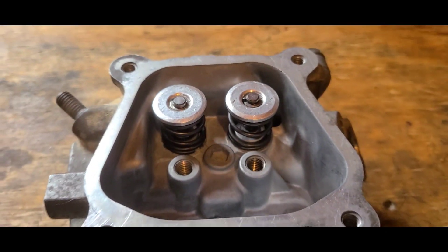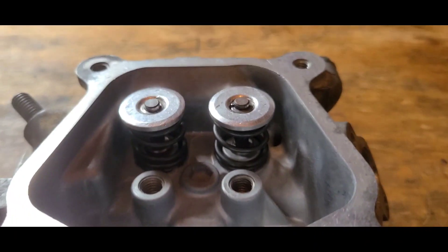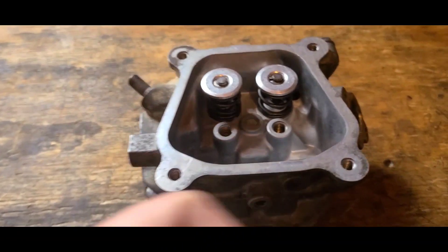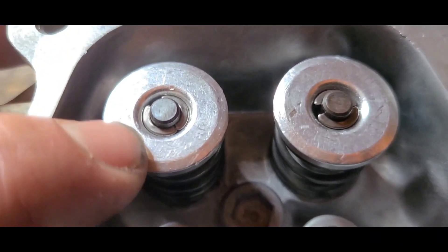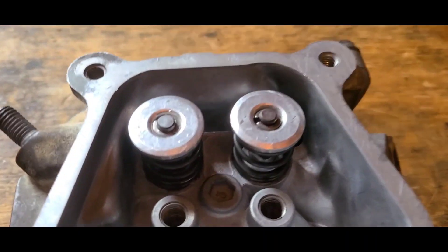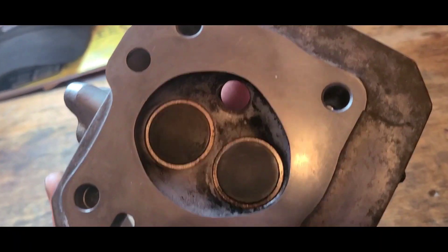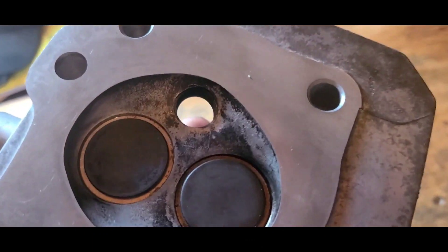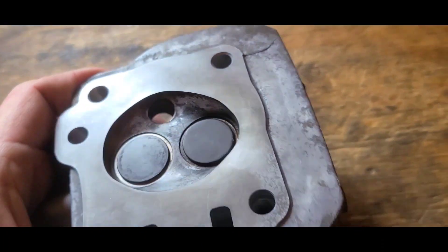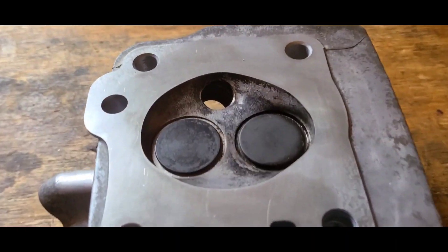These billet split retainers aren't the hardest and they're not the easiest. With the .22s, not that bad — I was able to do them with my thumbs. I just do one of the retainers at a time; that's what works for me. Now that these valves are installed, we're going to get a spark plug in there and we're going to try to find out what the volume of this combustion chamber is.